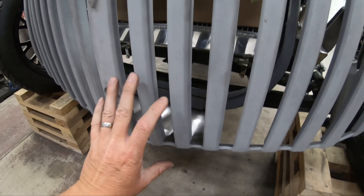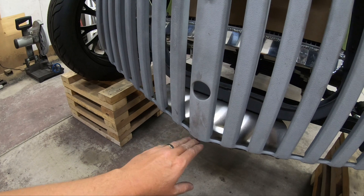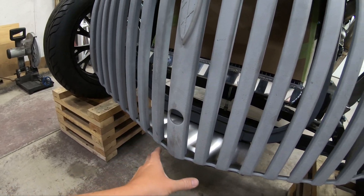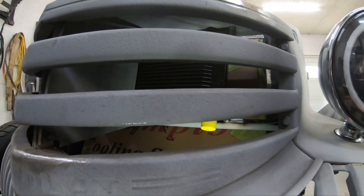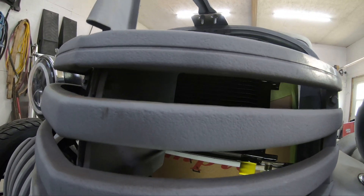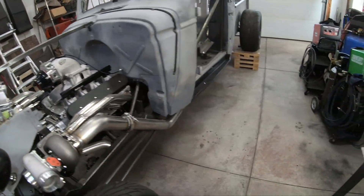It's a 15-row oil cooler. I was going to mount it down near the bottom, but if my measurements are correct I've got five inches of ground clearance in the front. If I happen to drive into a steep parking lot and bottom out the nose, the oil cooler would take the brunt of that. If I whack the front end on something, hopefully I can still drive home with it a little mangled - but if the oil cooler is down there, probably not going to drive anywhere. So I decided to put it up high in there. That should be enough for this motor.